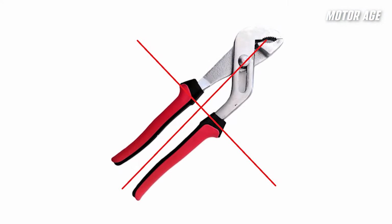First, if the joint is serviceable, meaning it has a grease zerk, it's best to check the joint for play before adding any grease. Also, we want to be checking the joint by hand, so don't use any large channel locks or pry bars. These joints control radial forces and are designed as such. So applying a heavy load, like a set of pliers, to squeeze that joint for play can apply forces in places it just wasn't designed for, and damage will be the result.